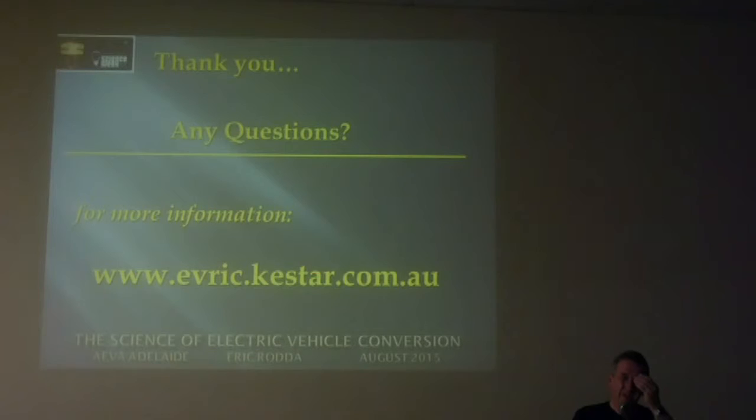Number one, the guy that made it for me, Ray Hammett from Hammett Precision Engineering, likes using steel. It's a lot easier to work in the lathe than aluminium. And if it was aluminium, it would have had to be thicker, and I think that would have probably run out of space. Because it only ended up like half an inch thick, and a lot of aluminium ones are more like an inch thick, and it might have been too close to the side wall of the engine bay with the auxiliary shaft.